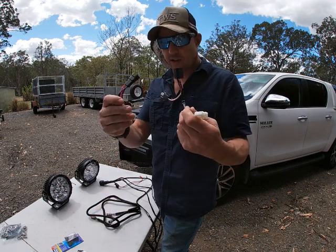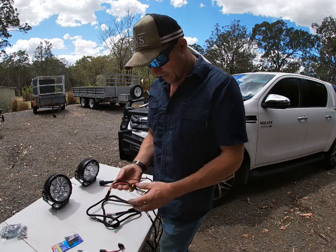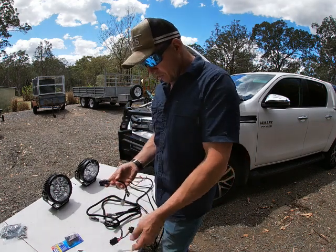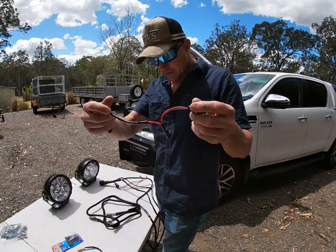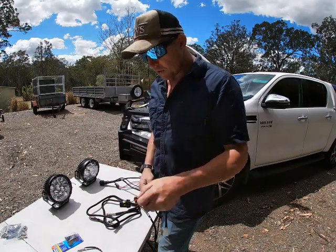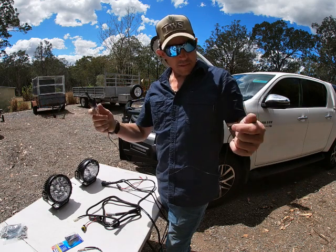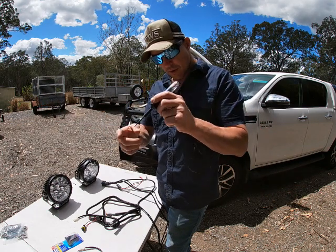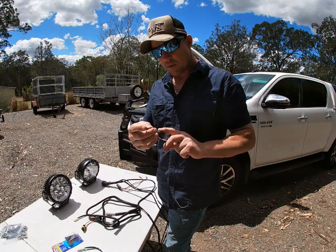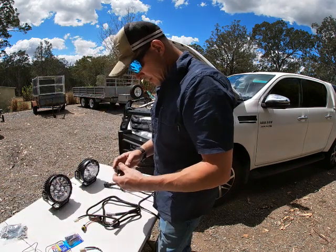And we're going to see if all these fit the Hilux. I doubt it, so I'll have to come up with a plan. Okay, I don't know if they run this. I don't know if they run that. We'll have to have a look. All we're doing is just making sure that we've got that power from somewhere. And if not, we'll use our trusty test light to put the high beams on and make sure which wire is that switching wire on the high beams, and we use that to switch that relay. All right, which is pretty sweet.